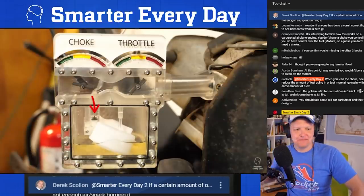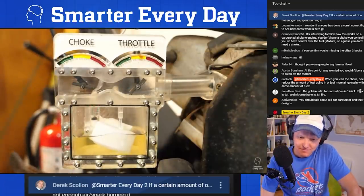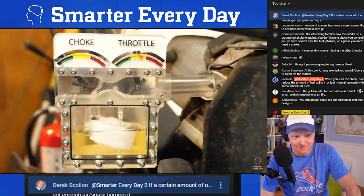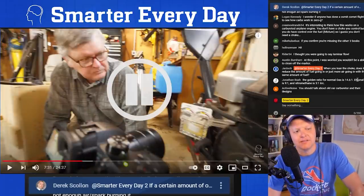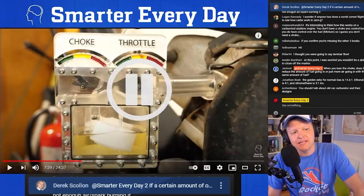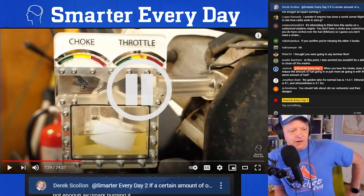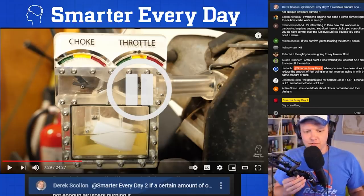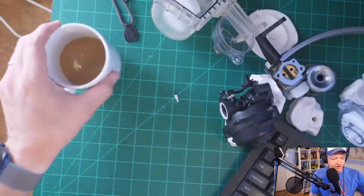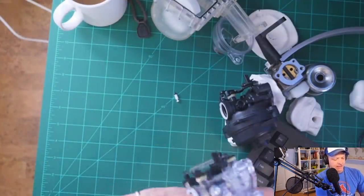Fuel flows in here, and when the float starts to float, it moves this needle, which presses into the seat and stops the flow of fuel into the bowl, so you always have the right amount. So one thing that was interesting about that is the needle, I feel like I could have done a better job explaining this on the video. So let me show you what I mean by that. So let me come over here to the coffee cam, and we're going to look at...